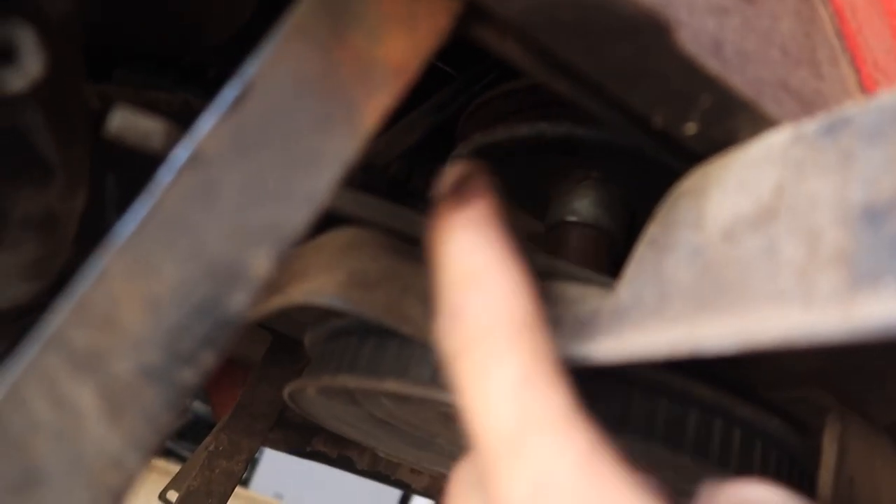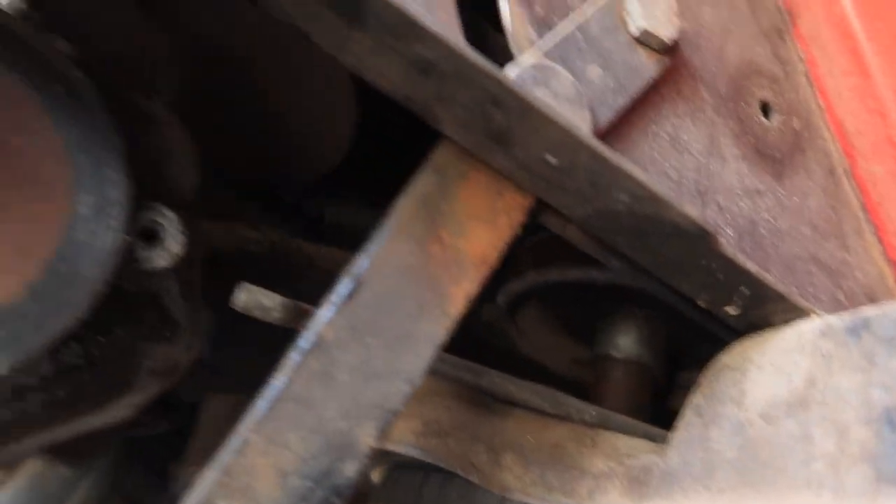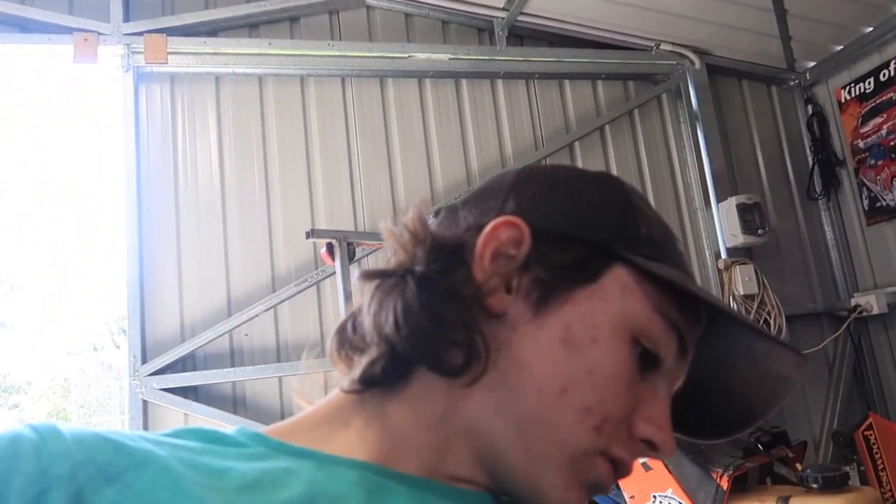I can see the jackshaft from under here — there's the top and there's the bottom. It's all clean now, they just go on the way they came off. When I got it driving this time it wasn't fluctuating at idle or in the revs — it was going quite well. But it was very touchy, either pretty much full throttle or idle. I think I just need a bigger spring because my foot is so heavy — it's just on or off, not very gradual.